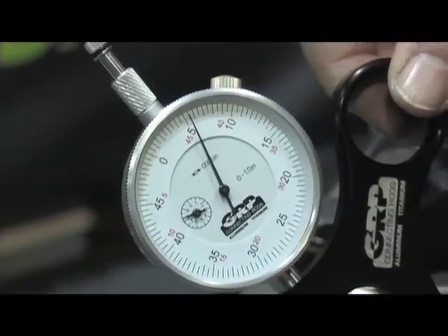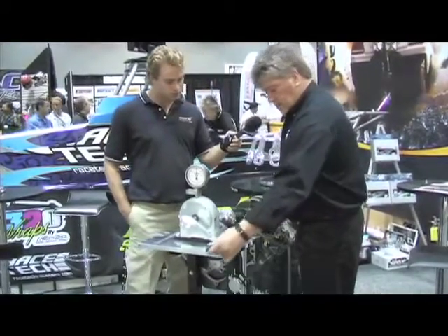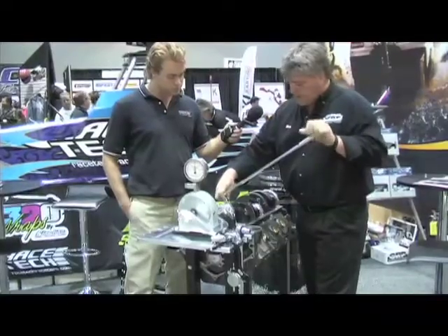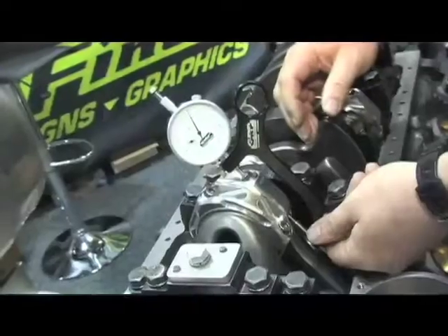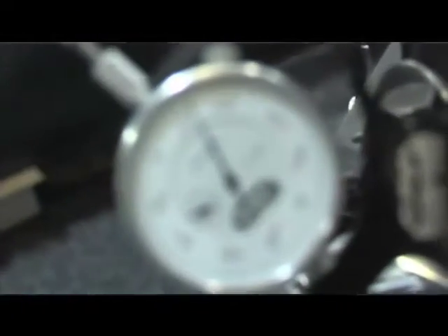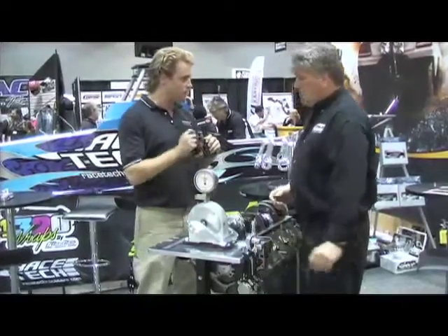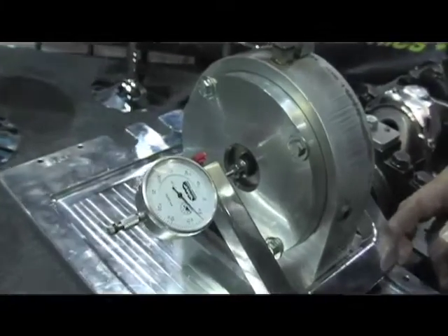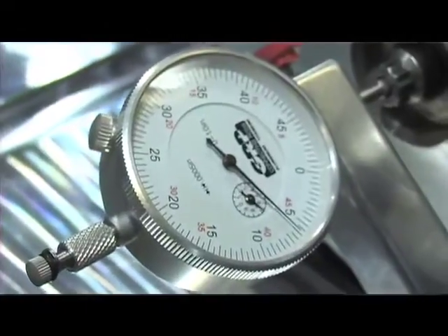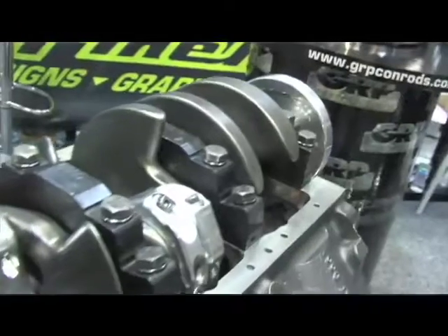What we want here is five and a half to six thousandths on this bolt, and I'm just a little shy of that. So I'm going to stick my bar on there and just tweak it just a little bit, and put the gauge back on. We're dead on — we're dead on six thousandths right now. So according to the torque wrench when it was actually tightened down, it wasn't quite tightened down enough — where it needed to be. We just bumped it up just a little bit. This bolt, at six thousandths stretch, actually has fifteen thousand five hundred pounds of clamp load. So we've got fifteen-five and fifteen-five — thirty one thousand pounds holding that rod together.